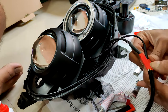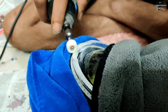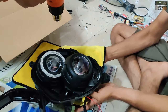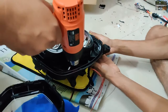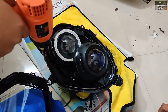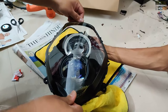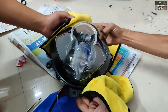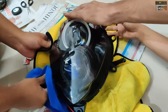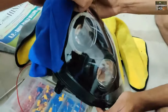Before putting everything back we tested the LED ring and it worked fine. We then realized the ring was touching the lens, so we filed and polished that area so it doesn't look odd. We heated up the butyl glue — baking the headlamp — then reheated the glue before fixing back the lens, which is the ideal process. I made sure to press and seal the lens well for weather protection.